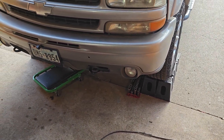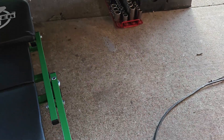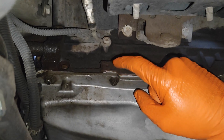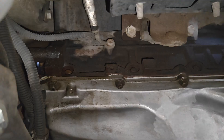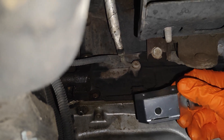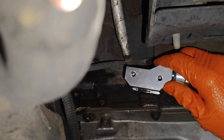The camera's going to get shaky here, but that's so you can see the process of getting down underneath the engine. We're over here on the driver's side first. Looking at the wheel from this angle, we turn up to look at the engine block — right there on the left is the bolt hole and the pad we're going to use to install the driver's side adapter. Depending on whether your engine is nasty or not, you may want to tap that hole with a tap before installing. See that shelf there on the back — that's going to go up in this section, and the bossed portion is what the bolt goes through.